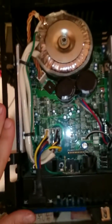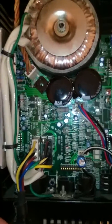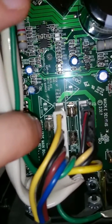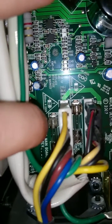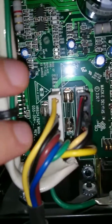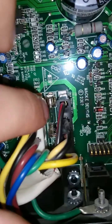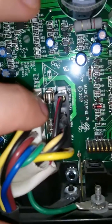Make sure you're unplugged from the mains — goes without saying — and with your circuit board the first thing to check are the fuses. There are two on this circuit; they're the same fuses: T800, which is T for time delay or slow blow, and 800 for 800 milliamps, 5mm diameter, 20mm length. You can get these in packs of 5 or 10, so they're easy to come by and not expensive. Even if they look okay, do a continuity test across both terminals. This one was actually blown for me but it looked okay, and I went out and changed the capacitor even though it turned out to just be the fuse.